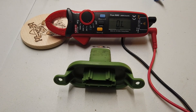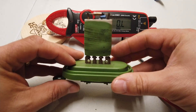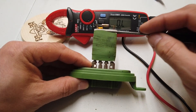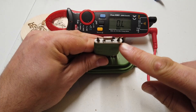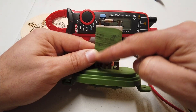The next question on everybody's mind is what has failed in this to cause everything to stop working. I've tracked it down — it's the thermal fuse here up on top. This is just a resistor pack that sits in front of the fan; when you turn the fan on it adds an extra coil of wire in front of the motor to slow it down. This is a 192-degree thermal fuse. Inside we have a ceramic core with electrodes running through it and coils of wire.